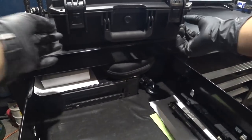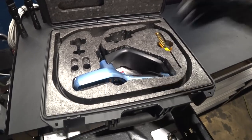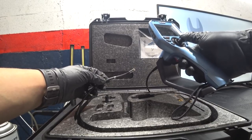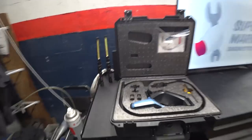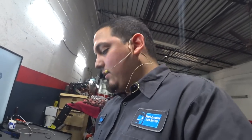Let me open this box — we've got the ME610 borescope. Zero complaints about this unit. It is a 360-degree articulating borescope; it does exactly what it says. I've used it to look into evaporators and confirm leaking evaporators, and also to go into cylinders to look at a leaking valve. In the Saturn video — the bonus footage — I went in and without taking the head out confirmed it was a poorly seated valve with this scope.